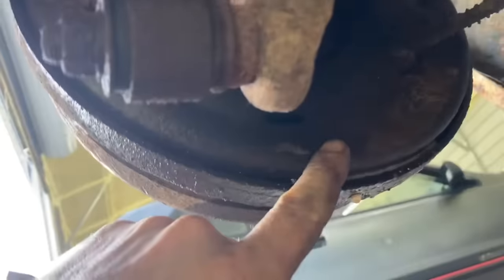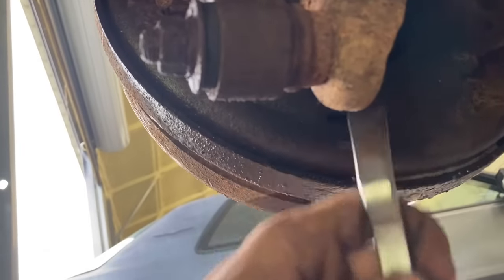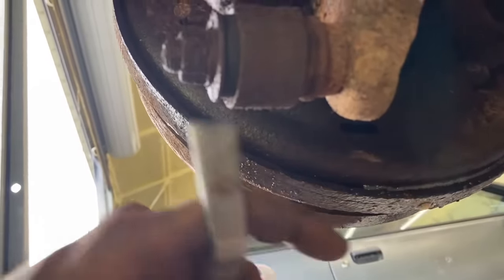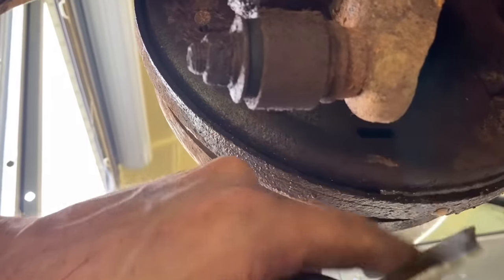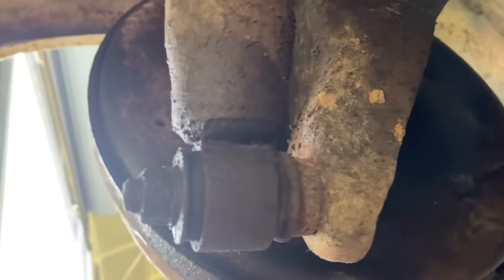I took the plug out down here. And the adjuster, I took my little adjuster tool and it seems to be stuck. So I sprayed some oil on it, which probably ruined all the brake pad surface. And I looked up here and these pins are not even connected anymore. So I probably broke them loose. I heard some parts falling out earlier.